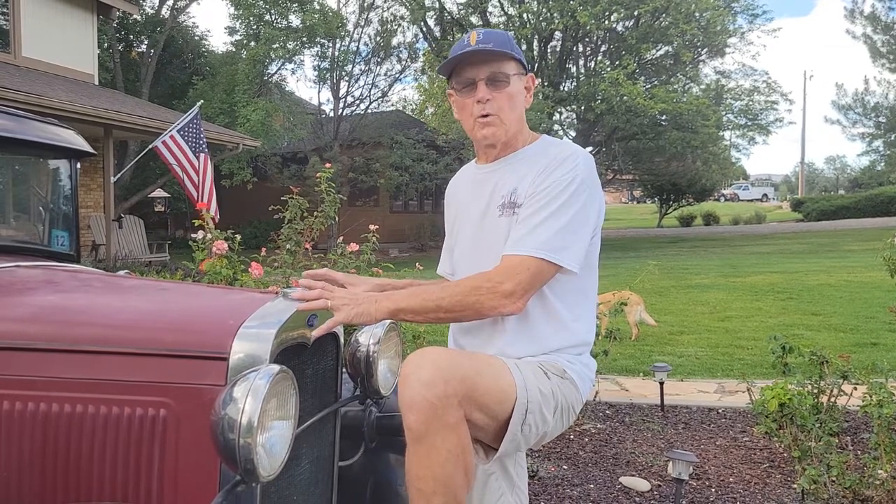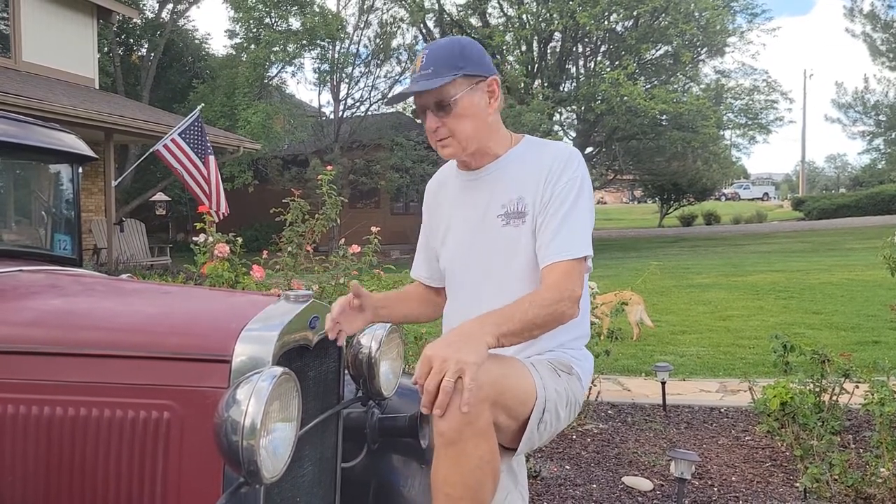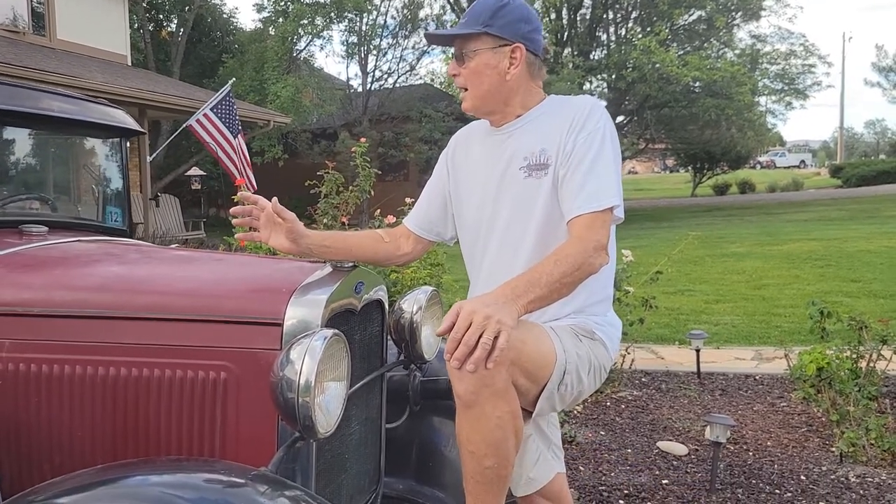I put a new six-volt battery in it, a brand new radiator cap, and filled the radiator with water — it was totally empty but it's holding water, so that's a good thing. For the carburetor, I got gaskets and replaced them — I didn't rebuild the whole carburetor, just replaced the gaskets because when I turned it on the other day fuel just flowed out. The dried-out paper gaskets needed replacing anyway, so I think it's ready to start.